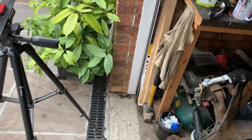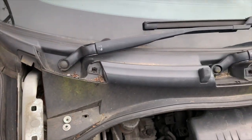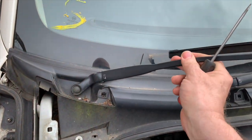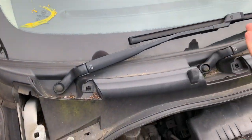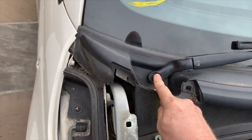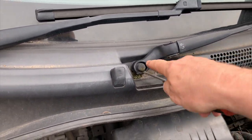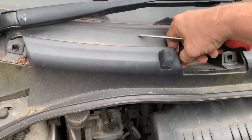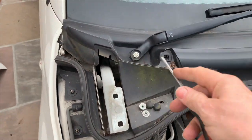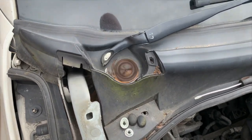The next thing you've got to do is take off the wiper arm bolts. If your bonnet's on, these can get in the way a little bit, so sometimes you have to bend them around and manipulate them to get them between the windscreen and the bonnet when the bonnet is open. To start with you need to get those dust caps off - just prise those off with a screwdriver. Don't lose them - they're only dust caps but don't lose them. Then you need a 13mm spanner on those to get them off.